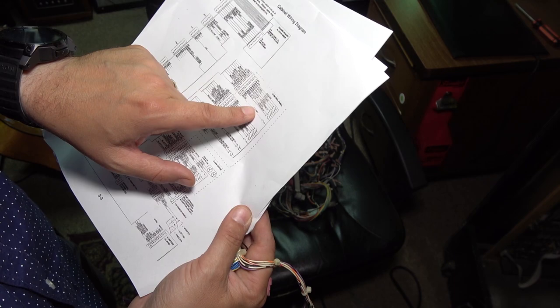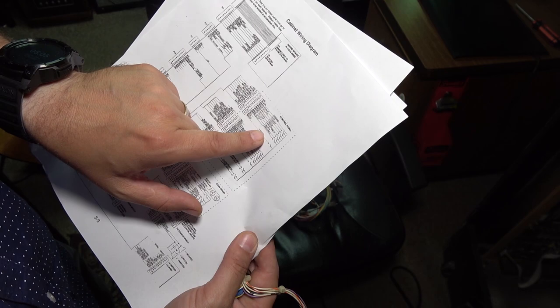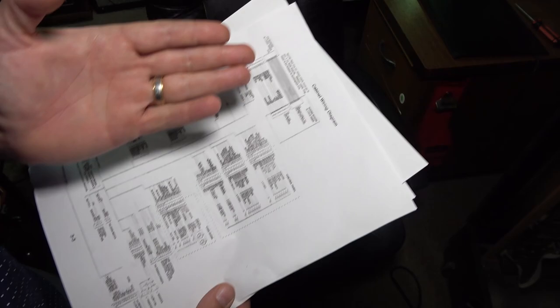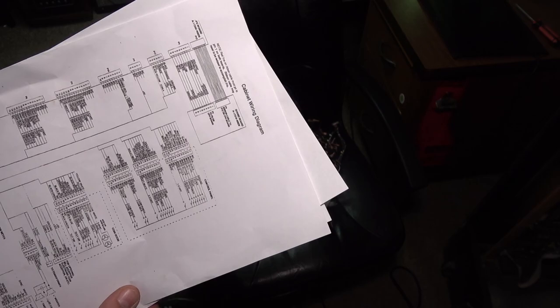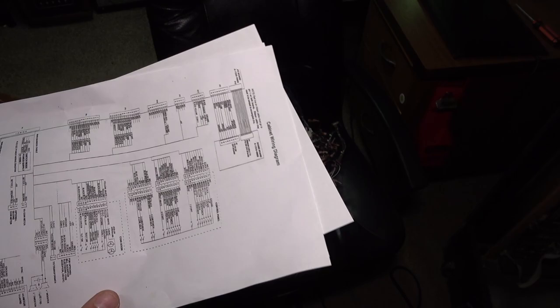All right, so the white and the black, the white and the brown, the white and the red is player 1: up, down, left, right, high punch, block. See, the JAMA doesn't have, JAMA is like a four-way, eight-way joystick and four buttons, I believe, is the max. And Mortal Kombat has 6 buttons, so they had to add like this kick harness, and Street Fighter is the same problem.